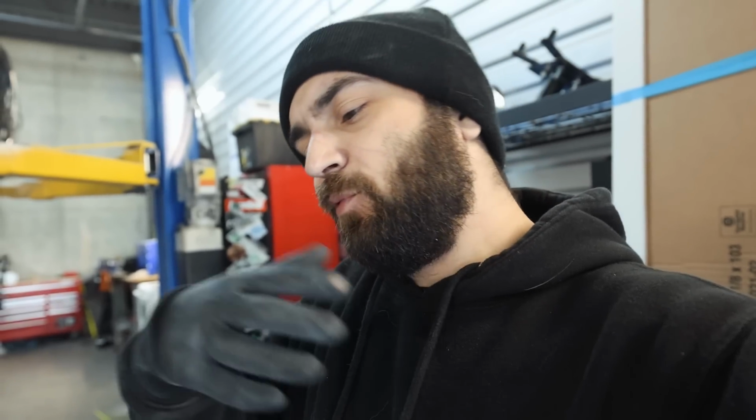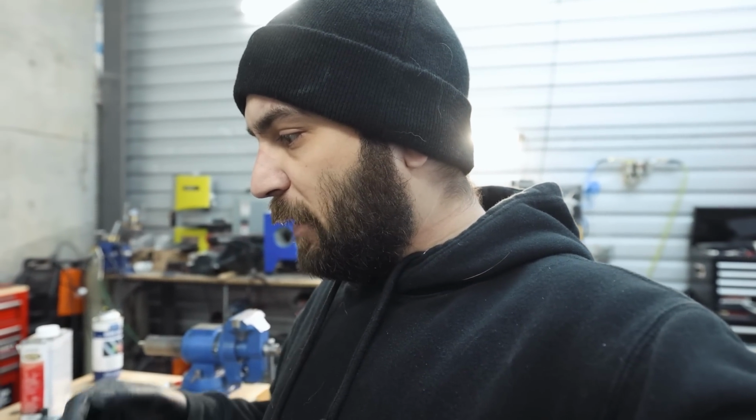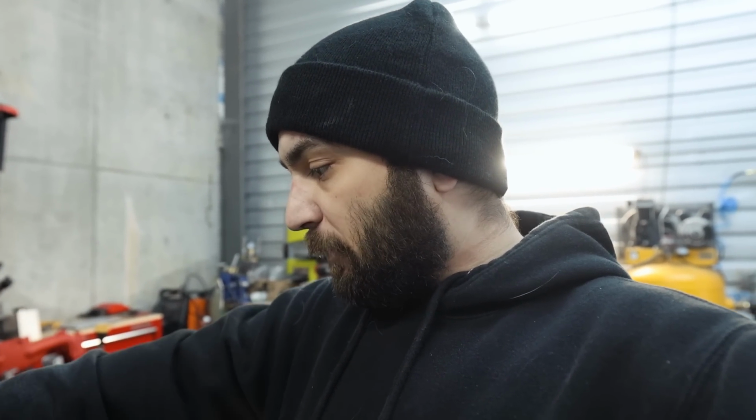It says for an extra layer of corrosion resistance, epoxy primer, and then that. So this time we're just gonna do it's not even body filler. I mean, it is body filler technically. We are using Eastwood's short strand filler. I don't want to butcher the name. Premium lightweight short strand body filler. I've been pretty happy with this stuff. It's got fiberglass reinforcement in it, and it works awesome.